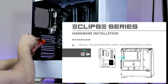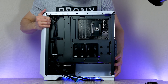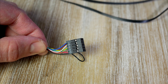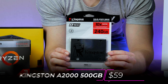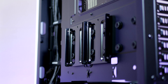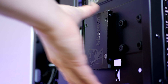We're going to use the screws provided by Phanteks. With the board installed, now is a good time to connect the chassis cables that take care of the front audio, USB, and RGB. Start with USB 3 — the connector is located at the bottom of the motherboard. Moving on to front audio, this cable goes to the left side corner. Next we have the front panel connector, found on the lower right side. The Kingston A400 is an affordable SSD — I'm demonstrating on the 240 GB variant, but for more future-proofing I recommend settling for the 480 GB version. To install the A400, remove one of the SSD brackets on the back side of the case, secure it using the included SSD screws, and put the bracket back in place.